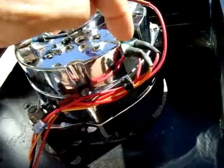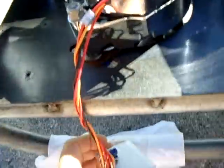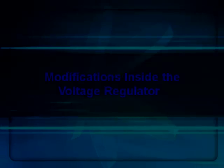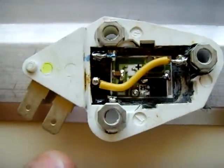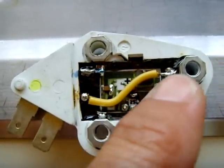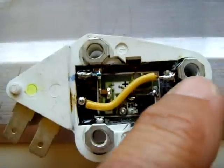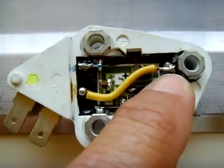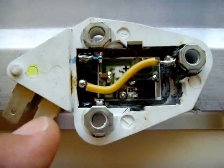So you've got a plus coming off the battery, a diode trio wire, and two brush wires — one for each end of the rotor — plus a neutral, and it all goes to the circuit. I'm removing this internal voltage regulator and mounting my own on the outside of the alternator. I cut all the circuitry away from the post. This post is where the diode trio connects, this one goes to the field on the rotor, and this one is ground. I bypassed the field wire so I have that connection available — my external circuit will connect there.